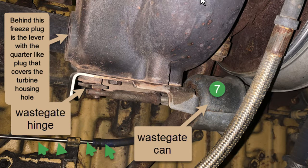So the air pressure is trying to collapse the spring, and if it's able to, then the rod will move out, and when the rod moves out it uncovers the hole in the turbine housing and then our turbo slows down very quickly because we've lost turbo boost. I want to clarify that the turbine housing is what we also call the exhaust housing on a turbo, but the correct terminology is turbine housing.